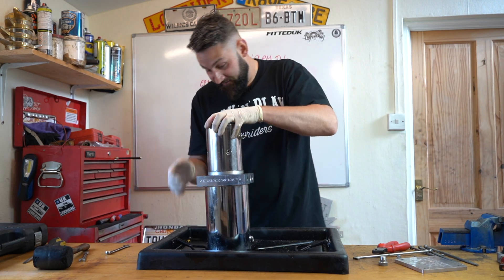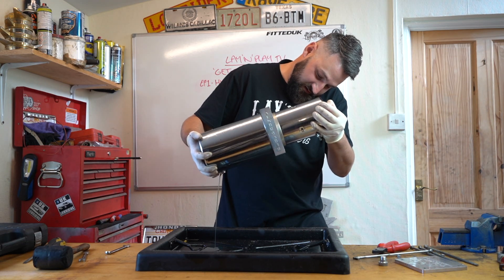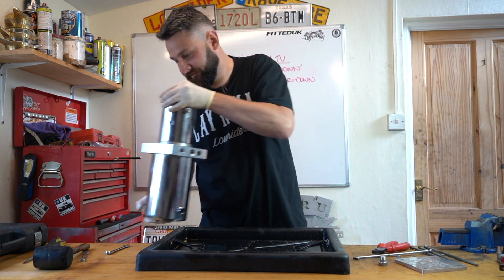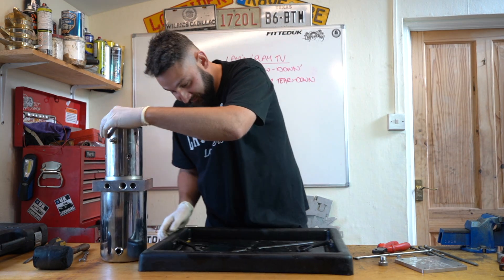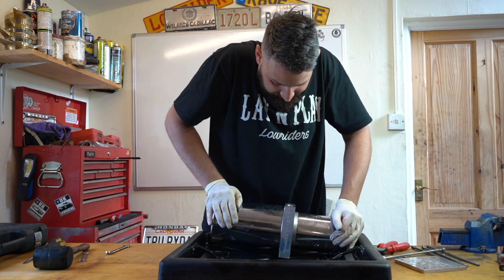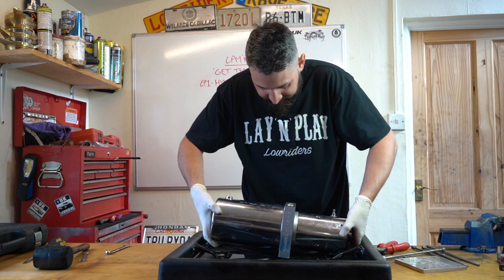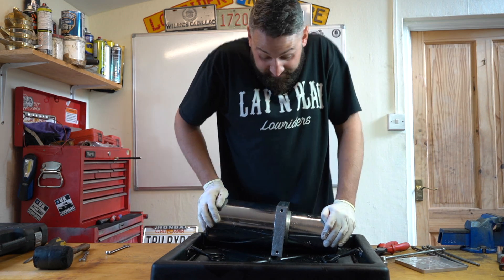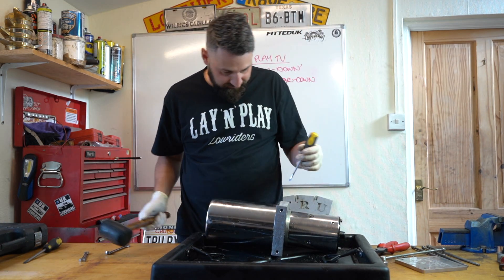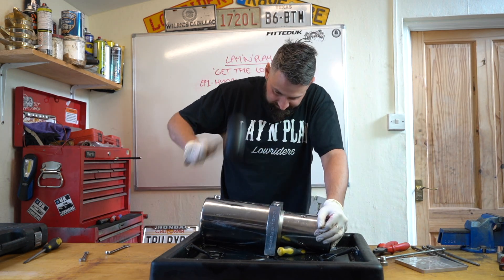These are really heavy when they're full of fluid. I'm pretty sure these have been pre-drained, but there's a little bit in there. Sometimes getting these tanks off can be a bit of a pain because they're tight - they've got a great big rubber o-ring. Putting my weight on there isn't making any difference. I don't like doing this, but there is a way of knocking them off. Sometimes you can actually knock them off just with the mallet and it'll break the seal itself.